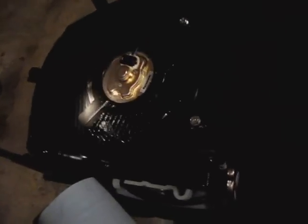The next step is to take your whole radiator out. There's a screw right there, one on the other side, and one more there. I highly recommend taking the radiator out — there's also a fan plug you need to unplug. I tried to do it without removing the radiator and could only get to one screw; for the others you'll have no room to work. Pull the radiator and then use a five-millimeter allen.